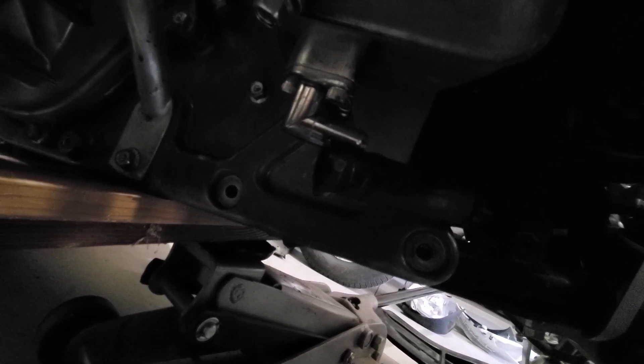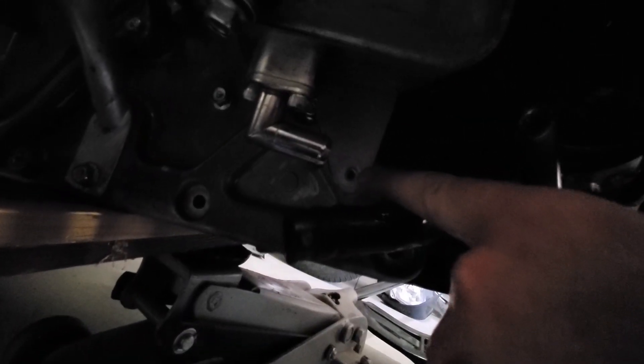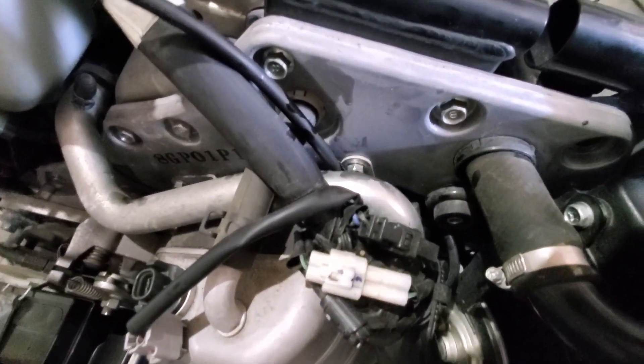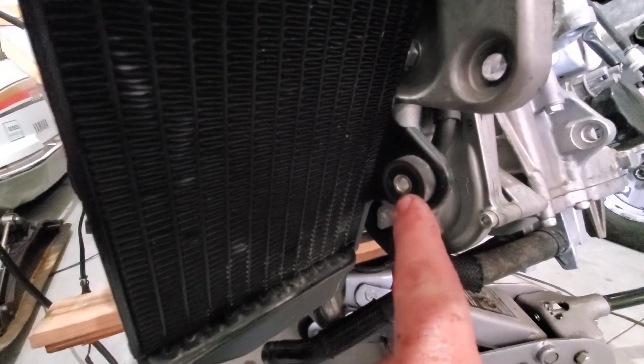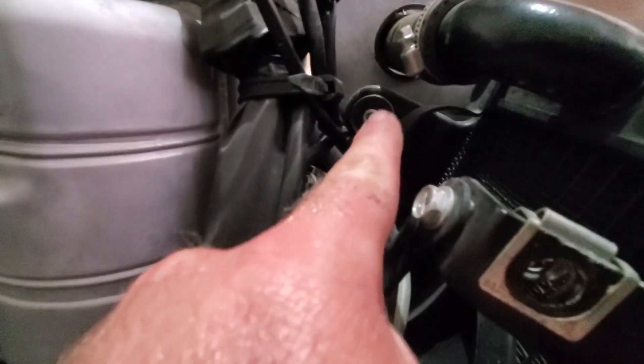I also discovered that there's one more bolt right behind the oil tank that needs to be removed. To do that, you have to loosen the oil tank with the bolt at the bottom, then the bolt here on the side, and then the other side of the oil tank. That should allow the oil tank to wiggle just enough to get to that bolt. There's a bolt in the same place on the other side of the sled — that'd be the left side. I also found one more bolt that I'd missed, which was on the lower front of the radiator. So the radiator actually has three bolts: one in the front, one in the top back, and one in the bottom back.